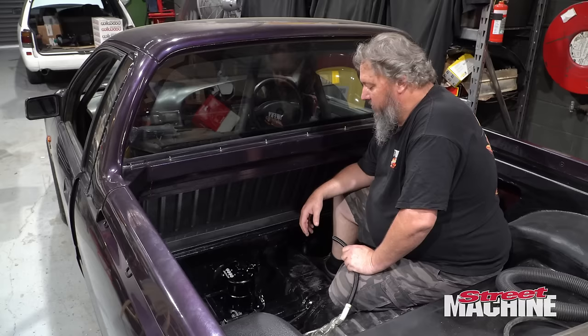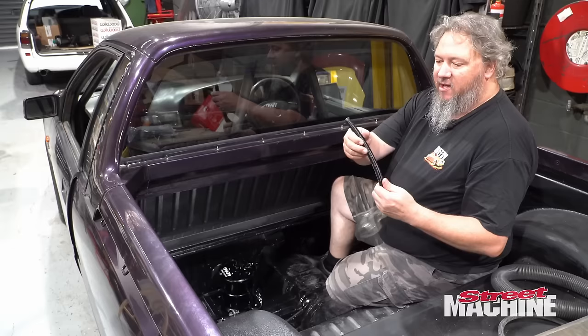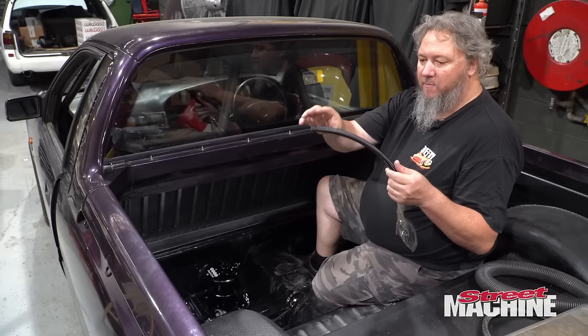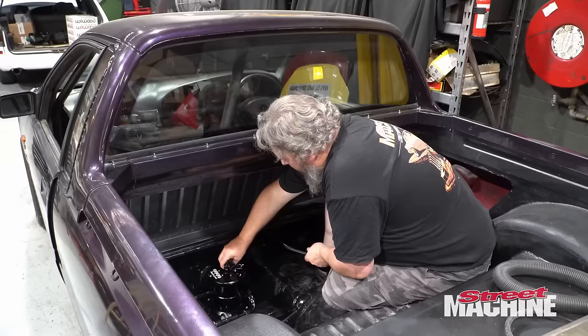We located our surge pot earlier. I've put the filter in there and obviously I'm going to have to run a line from there to there. This will be the feed line — Dash 10. We're going to use Teflon like we did on the Lexan. The only issue with Teflon is it doesn't have a very tight bend radius. With the Dash 10 stuff, I think the bend radius is 170mm, so you've got to keep your bends gradual. You can't just go leaning on it because if you kink it, you ruin it. I will work out our length here.